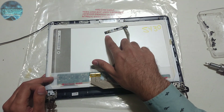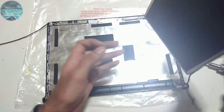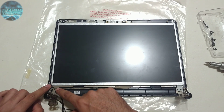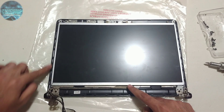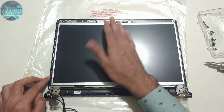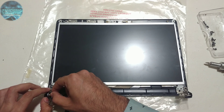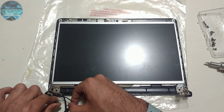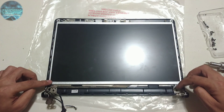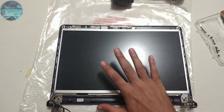I have the strip connected with the screen. Once I turn the screen over I'll place the camera in the two slots and secure the screws. When placing the screen you have to simultaneously manage the wiring — the upper wireless antenna wire goes all the way from here and out from here. Make sure the camera is sitting properly and the LCD cable comes straight to the connection. Both wires meet and come out from a loop at one of the hinges. Once set, four screws hold the LCD in place.